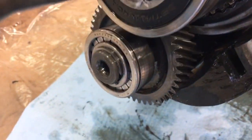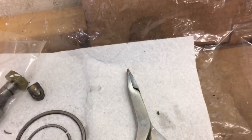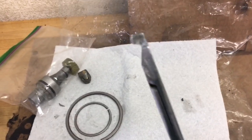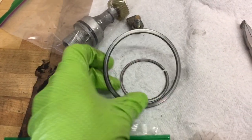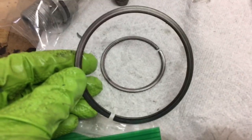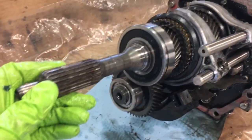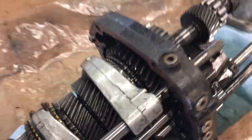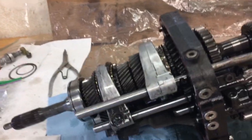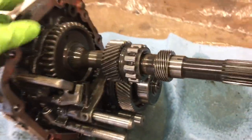Before you do that, however, you'll see there are a couple of rings with retaining rings, and you're going to need a set of snap ring expansion pliers. Before you start hammering, be darn sure you remove those snap rings from these bearings, because this case is not going anywhere until you get those two rings off. That's all you need — just the outer rings, this one and this one. There are nine bolts total. Once you've done that, you can pull off the front case. Of course, drain the transmission first unless you want gear oil everywhere.